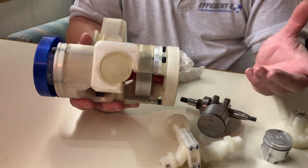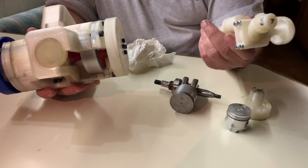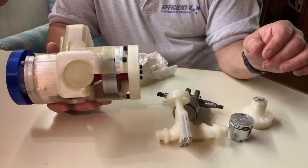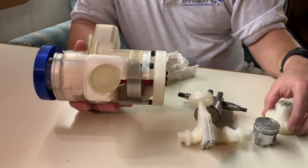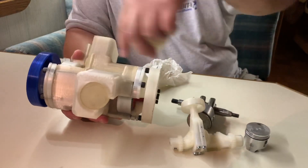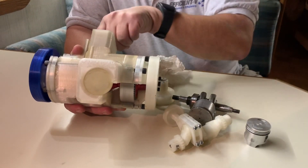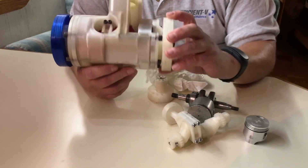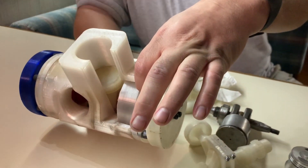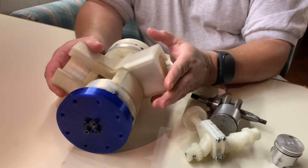Balance is very simple in this design. You might look at it and think it's not easily balanced — there's no balance weight shown on this crankshaft, just for simplification, this is just a model. But you would balance this as you would conventionally. At each end of the block there's what we call the drive member, and it's counterweighted. That counterweight is always opposite the reciprocating forces of each of the pistons as it goes around. At bottom dead center the counterweight is up in this region, so it's easily balanced and actually a little bit smaller.